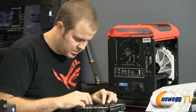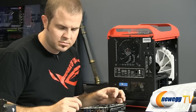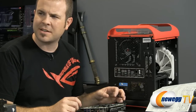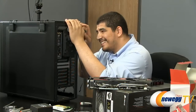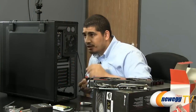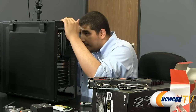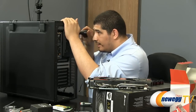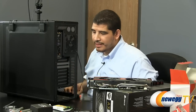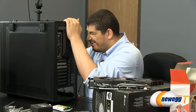Do you have to overclock your CPU in order to use overclocked memory? No. Well, how do you define that? Because you're overclocking the IMC, right? It's a tricky answer, but technically no. You could run your CPU at stock and go ahead and enable your XMP profile. But if you're buying a K part or an X part and you're not overclocking it, then you should not have bought a K part or an X part. Yes.